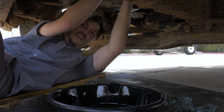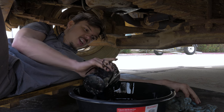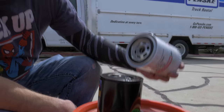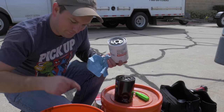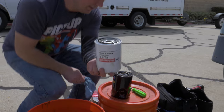Getting a Napa know-how. It has your Ford small block filter. I swear I was like, 'it's going to be a Ford for sure.' See the rubber meets up perfectly — that's what's important, not so much the height. You can change that. Drop of oil, move that bad boy up, put that bad boy on. And you owe me a filter — so we got the oil changed. I think we concluded it takes about seven quarts of oil, quite a bit.